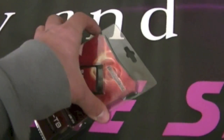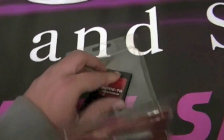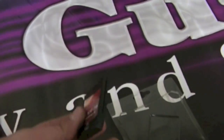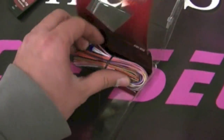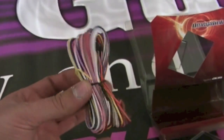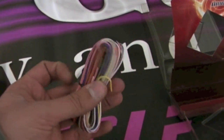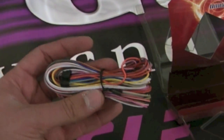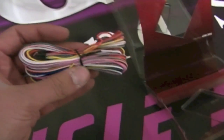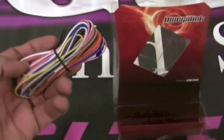So what's involved — I'll open up the package and give you an idea. You can see the blade here; it actually just slides into the remote starter brain. This is the remote starter interface harness, with lots of wires — not all of them are used depending on the year, make, and model. These will interface to the immobilizer, oftentimes on the OBD2 connector or straight on the key barrel itself, or depending on the vehicle it might be on the BCM or behind the glove box — some Toyotas are like that.